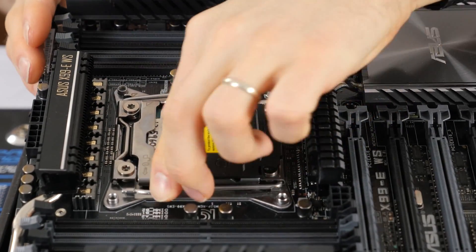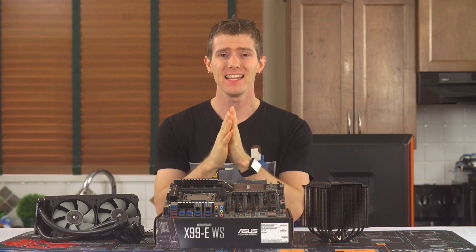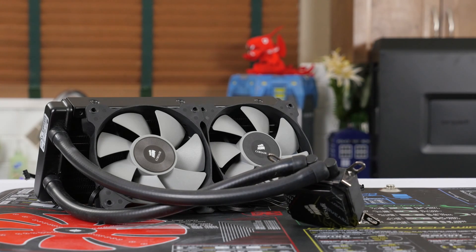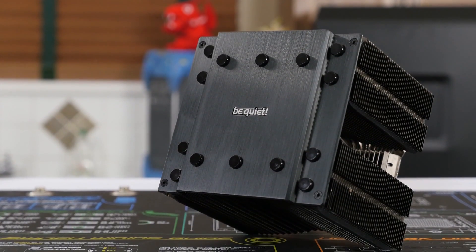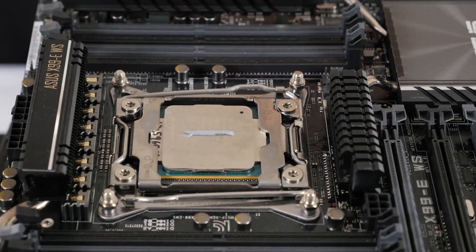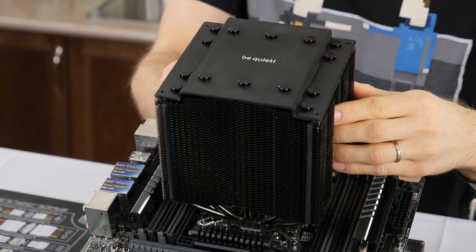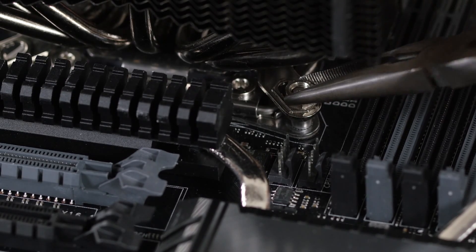While water coolers can be quiet, for a computer to be truly silent it needs to eliminate as many moving parts as possible. All high-performance CPU water coolers have at least three: a motor in the pump and one motor in each fan. So I went instead with a massive be quiet Dark Rock Pro 3 and removed its cooling fans outright, for a total of zero moving parts. Screw the four posts into the sockets around the CPU, apply a thicker-than-normal line of thermal compound to the processor, then place the heatsink down and tighten the four nuts onto each post until secure.